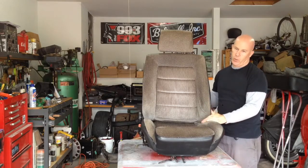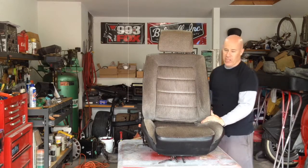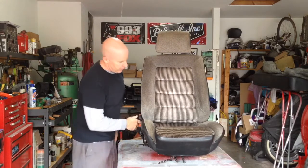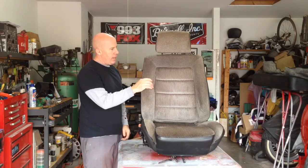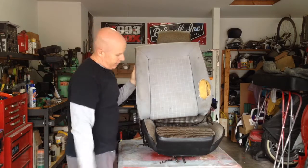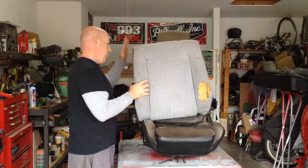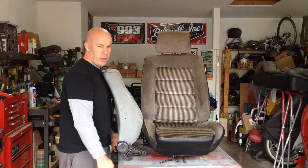The third issue is it does not work. There's a cable inside here and it is broken and we will be repairing that today. And while we're doing that, the fourth and hopefully final issue is this recliner. As you can see, it is broken and basically just adjusts one side — it's kind of twisted and crooked. The way we're going to fix that is I picked up this replacement back at the auto wrecker. I got it for cheap and it is not broken. So what we're going to do is pull this cover off here and basically switch the internals.